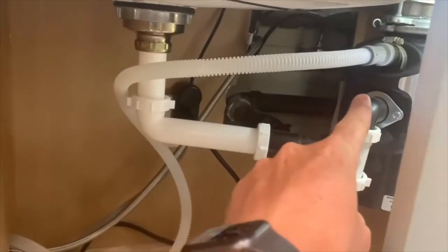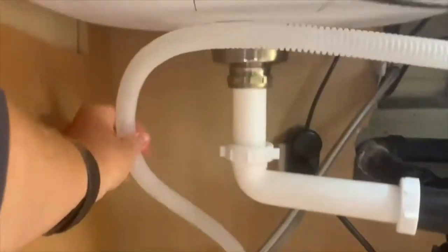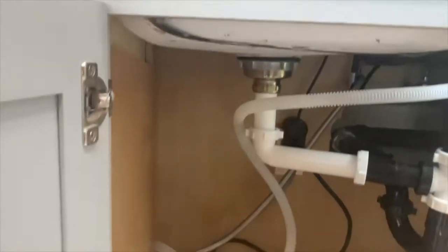So to quickly fix that, you just have to remove that. You're going to want to wrap it around the back side of this plumbing, plug it back into the dishwasher, and then mount it so that the drain line forms an upside-down trap — make it look just like this one here — and tack it to the underside of the cabinetry.